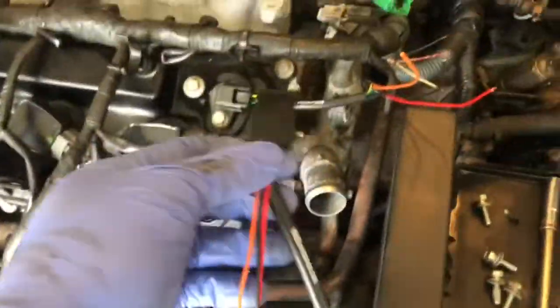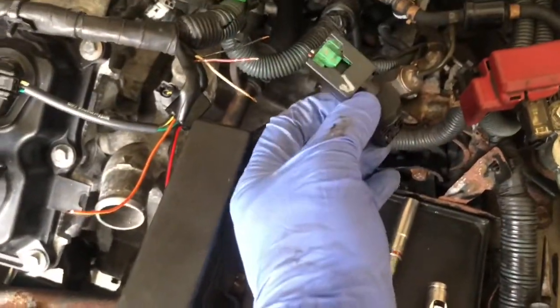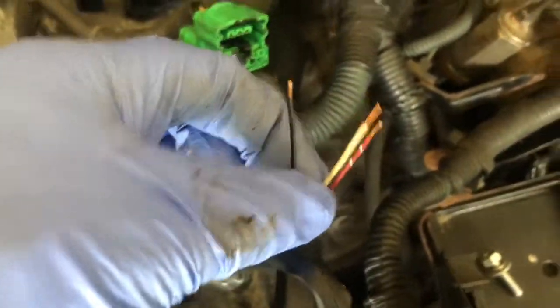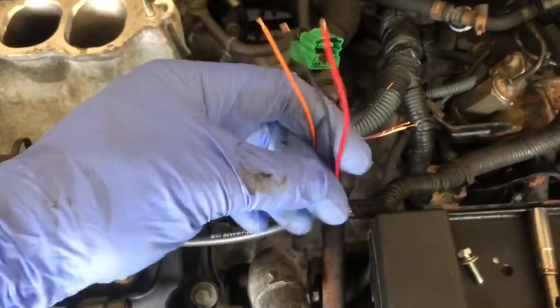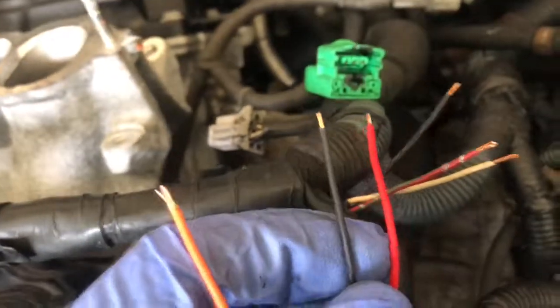Yeah, we are doing the cam signal inverters. So what I've done so far, just to give you guys an update: this is the cam positioning sensor. It went here on the harness. I cut it. You can see the same colors here, and then I stripped the ends. With the cam signal inverters, go on nisformance.com and make sure you've got the right one. I've got version 2, so essentially it takes out all the thinking on the wiring.